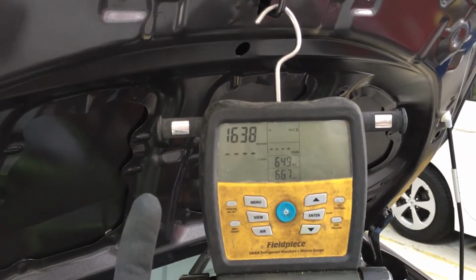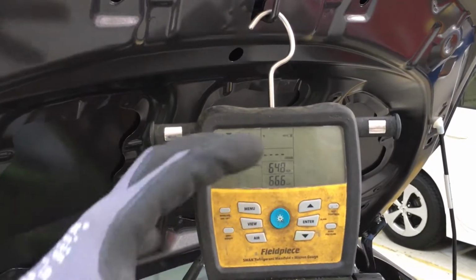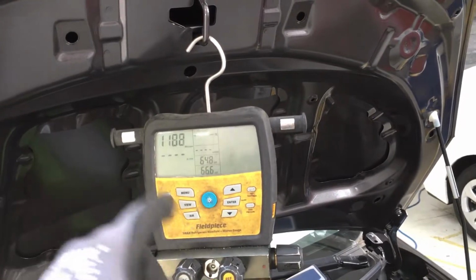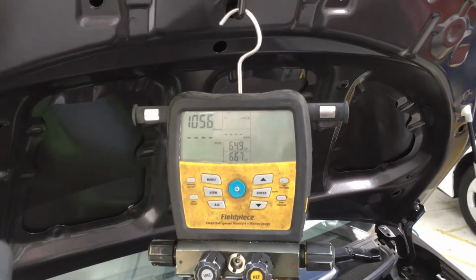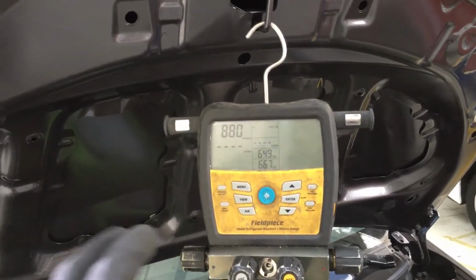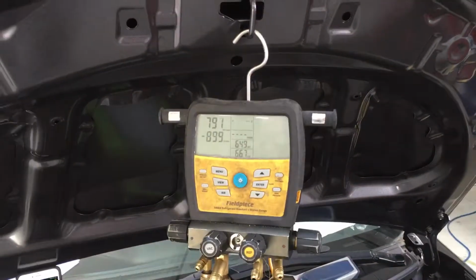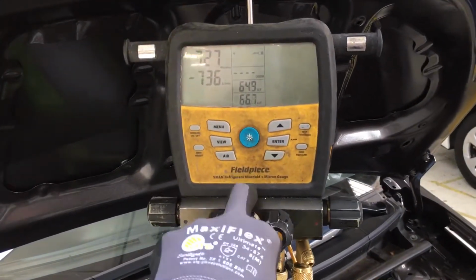Dry is very important. Having no refrigerant in the system, because you're fighting refrigerant blowing out and exploding out of the oil. And if you remember, when I did the recovery, my recovery unit took it all the way down to 700 or 800 microns. So I degassed the majority of the oil, so now it has little work to do when I'm pulling my initial vacuum. And if you keep track of how many seconds it takes for this to go down, I am reading the micron level right here.